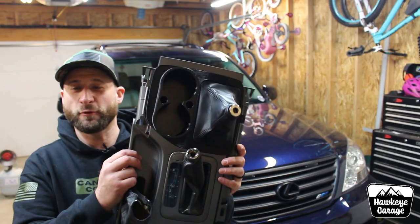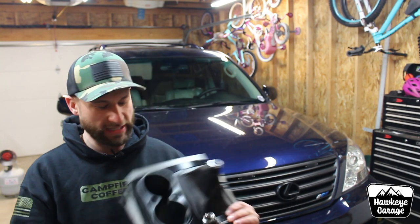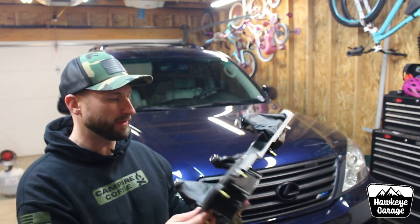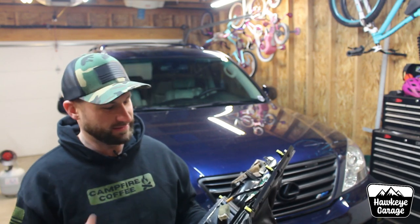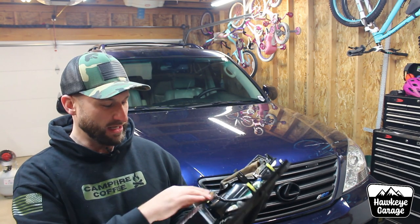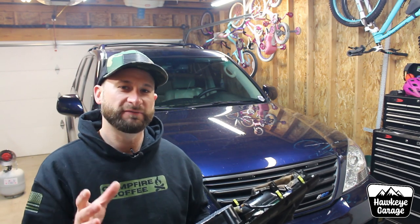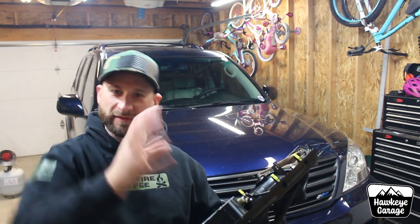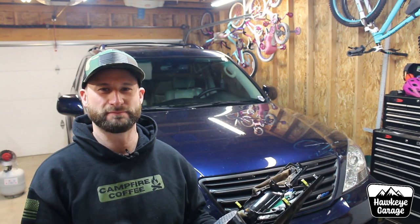I've got the panel out and I've already got the cup holder panel installed. When you pull the original wood trim panel out, there are some screws on the top and bottom and some clips — there's probably a wiring harness clipped into place, so just take your time and unclip it; it's incredibly easy to do. The shift boot for the four-wheel drive shifter is held in with just four clips on the panel — they'll be on the new panel as well. The shift boot is actually asymmetrical, so if it doesn't seem to be lining up, flip it 180 degrees and it should fit right in.